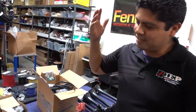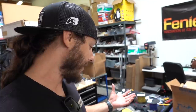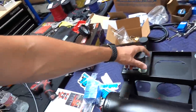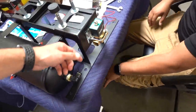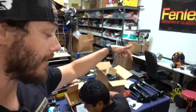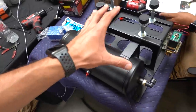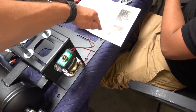Sergio is becoming the install master — iepusa.com, shoot him an email to get installed. It's not complicated, it's just time consuming. His dad is actually pre-wiring everything right now. We've done a ton of horn installs on the channel, but I wanted to show you this small setup — we're going to see how it goes together as Sergio starts building it. This might be a better option for some of you guys with smaller vehicles. We've got the dump valve — this is an electronic valve that dumps all the air at the press of a button. Wes is running a three-quarter valve, but the Nathan horns draw so much more air than the smaller diaphragms do on these plastic horns. The footprint of this thing is going to be really small.